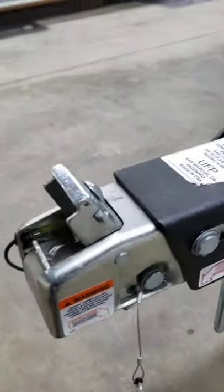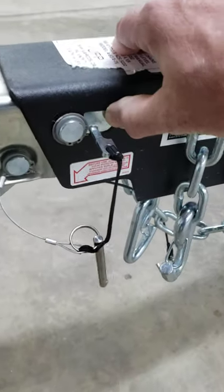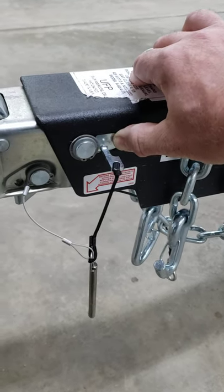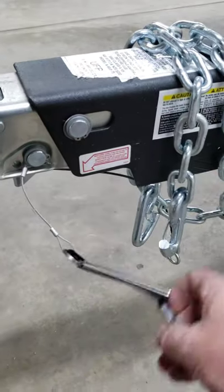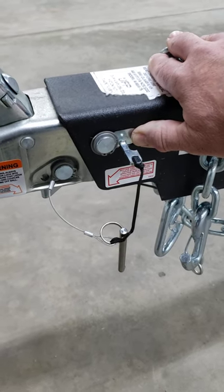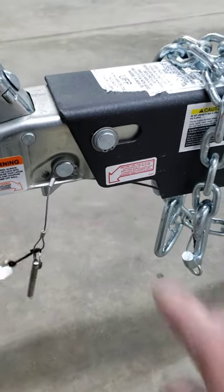What comes with the trailer — and if you don't have one, let me know, I've got them here — is this little D-shaped key. This D-shaped key can be placed in this slot when you're backing up. The thing is, it falls out, and it's meant to do that. They don't want you to just leave it in there because then your brakes won't activate under normal driving conditions. But you can put a magnet, or I've seen people put zip ties around it to hold it in. So if you have to back up and you've got an issue with your vehicle, or maybe you use a tractor or a four-wheeler or something at your house or farm to back your trailer around — we use a forklift — I have a magnet that holds this in so we can push boats around. That will keep this cylinder from pushing backwards and will keep your brakes from activating.